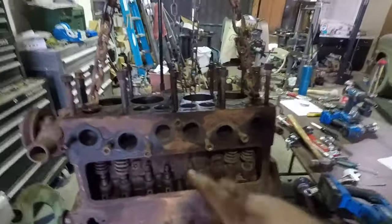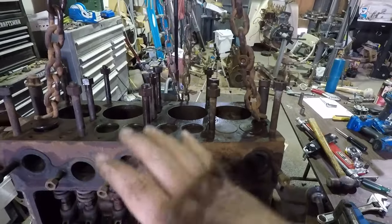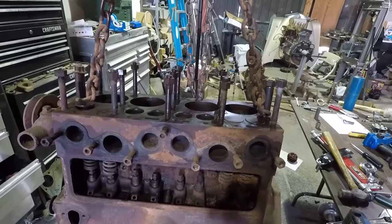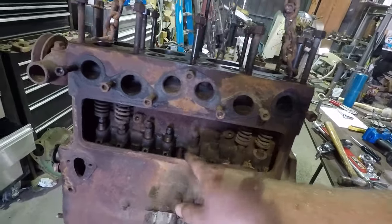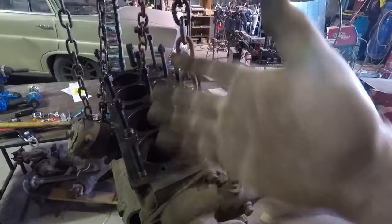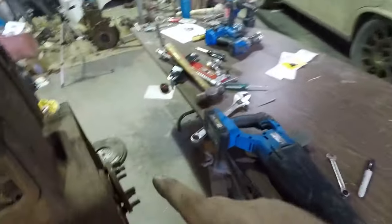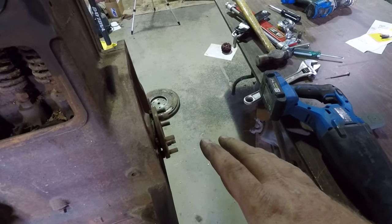I'm going to turn my attention to one of the other ones. This one I was originally not going to use because it's missing a bunch of valves — because this was actually an air compressor. It has been sitting outside. Inside is looking pretty rusty. It's missing a lot of parts off the front. But it has all the head studs, so I don't have to extract broken ones. It doesn't have a flywheel, so I've got to get one. I have two different flywheel options.